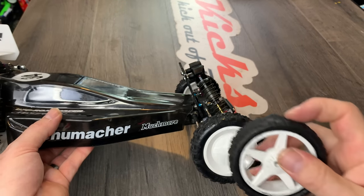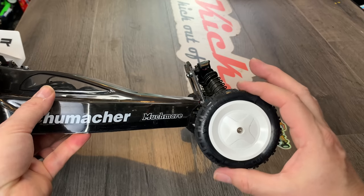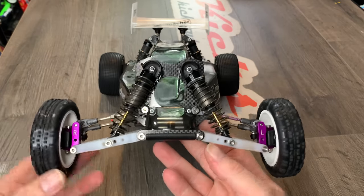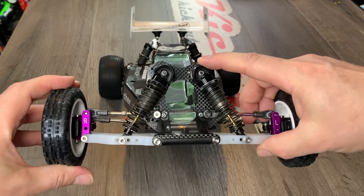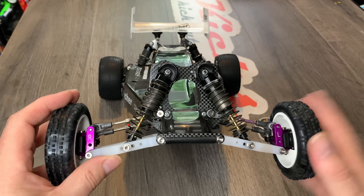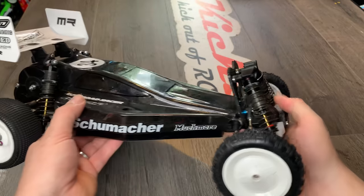These are a lower profile and much softer tyre. I've also got the droop set a lot more than I normally have. With a bit more droop and softer tyres, I'm hoping the front's going to bite a little bit longer so I can lean on the front under power a bit more. If you've watched a few videos and you enjoy the channel, please hit that subscribe button.